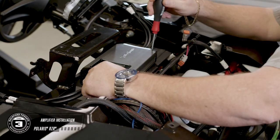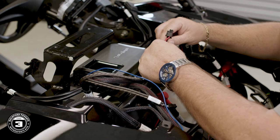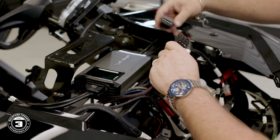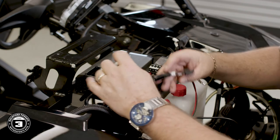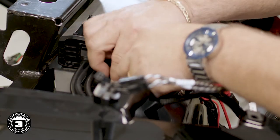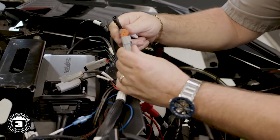At this point, you're ready to mount your amplifier using a 2.5mm Allen wrench. Now you're ready to wire the amplifier. These new M5 series amplifiers are equipped with our new preset technology as well as pigtails for your connections. Start with the output cables — your front output goes to the speakers and your rear output is for the subwoofer. Now connect your power plug. Then move to the input: plug in the harness labeled 'front' to the pigtail labeled 'front,' and the harness labeled 'rear/subwoofer' to the pigtail labeled 'rear.' Feed the RCA cables to the center dash for connection to the source unit. Now connect the blue remote turn-on wire, then match your speaker locations to the proper cables and attach.